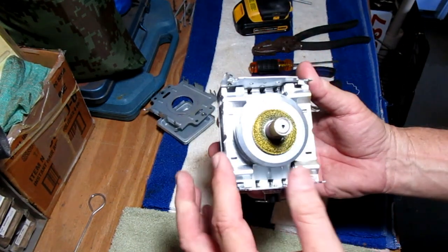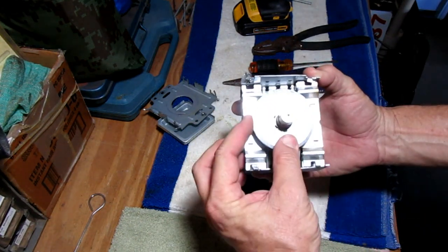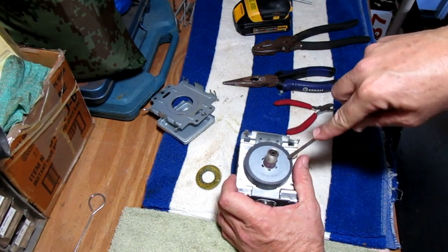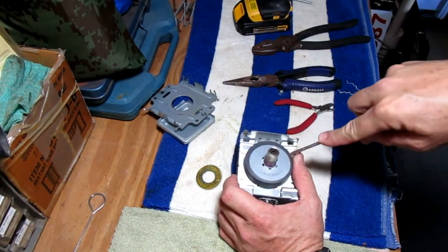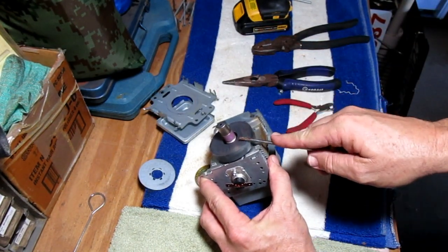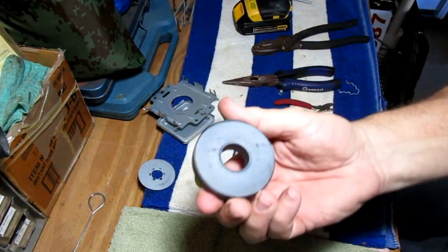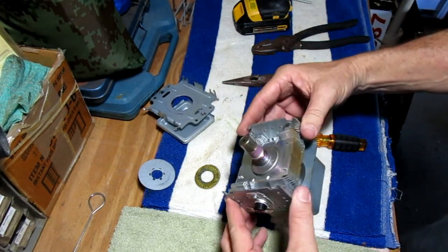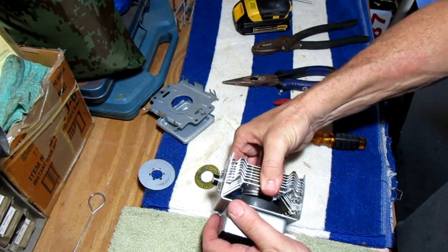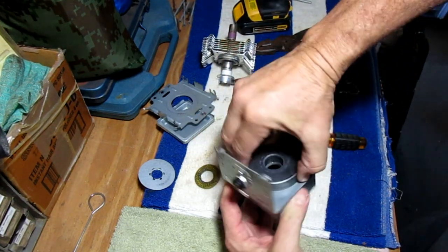That cover is junk. This magnetron has just a couple of parts in it. It has this little brass ring that we're going to take off. Now there's another small piece — a small washer — that's stuck on there because it's a magnet. We just remove that. You've got to be careful of that pink insulator — that's where the bad chemicals are. Now we can just lift one of the magnets out. There's one.